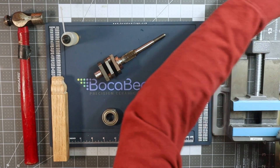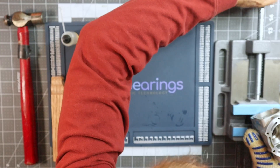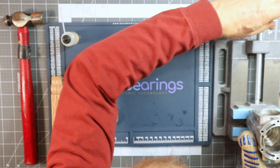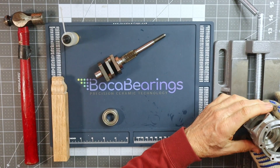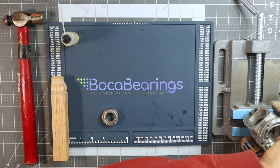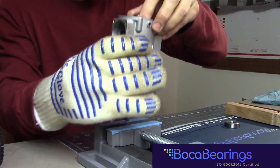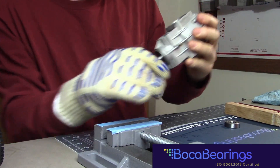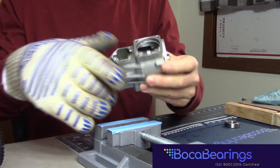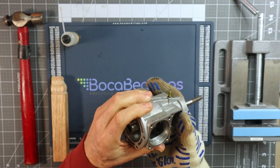I'm going to adjust my vise such that it'll sit nose down and hold it stable while I insert this last bearing. So now this one I'm going to really have to heat up quite a bit to facilitate this. All I'm going to do is heat this up, drop this crankshaft in place like that, and then we'll just tap it into place. In fact, it looks like I'm not even going to need to do that — either I heated this up just enough, because it looks like this bearing is fully seated right now.